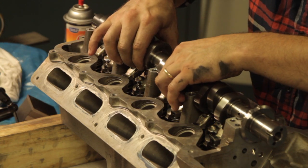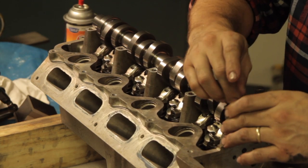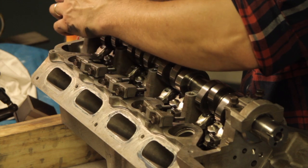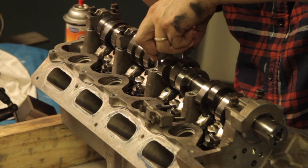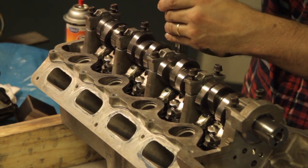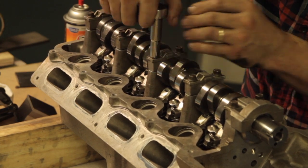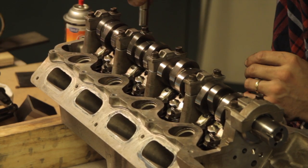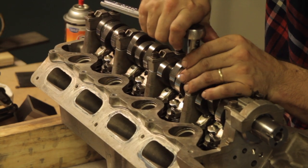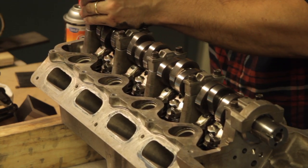It's important to note that I'm going a little bit out of order in my assembly process. Usually with these heads you would install the camshaft before the followers, and then using a compressor tool you would compress the valve spring out of the way and slip the follower in place. The problem is that method is a huge pain and the aftermarket valve springs I used were actually bending the foot on the valve spring compressor. The truth is this method can work just fine as long as you take your time and tighten everything down evenly.